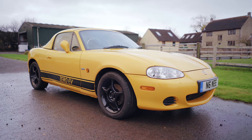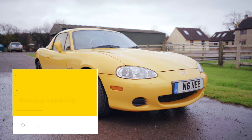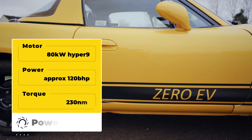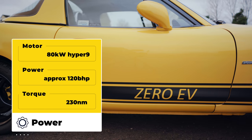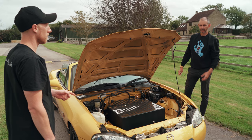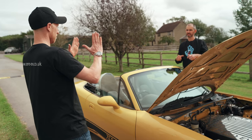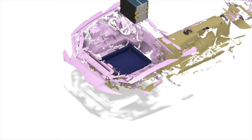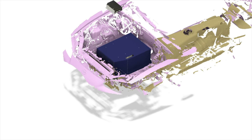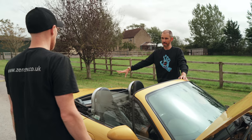So let's talk performance. Volts: just over 100. Kilowatt hours: 26. The motor is a single motor Hyper-9 — 80 kilowatts, which is about 120 brake horsepower, and 230 newton metres of torque. Maximum 8,000 RPM. And then there's a reduction gearbox in the middle — it's as narrow as the Hyper-9, so you end up with one unit that's the motor and gearbox. That comes out to a yoke which goes straight into the prop shaft, so it still has a prop. The gearbox is a 1.8 to 1 reduction, which is standard to the standard rear diff — MX-5 rear end, exactly as standard.